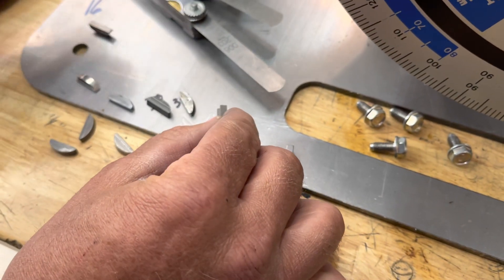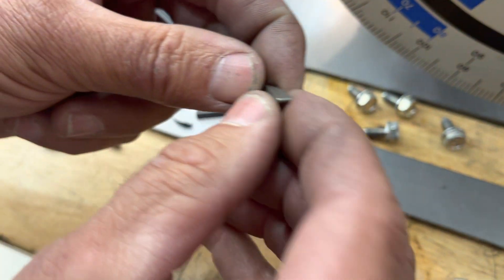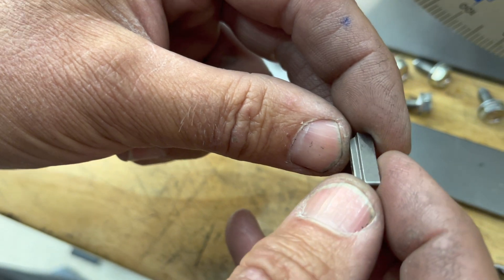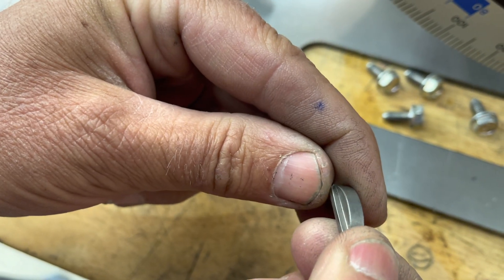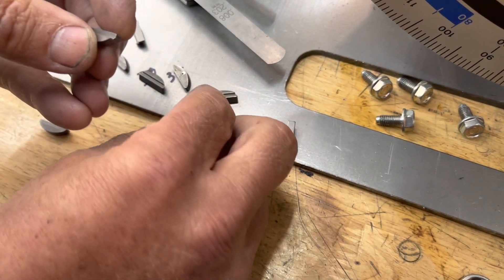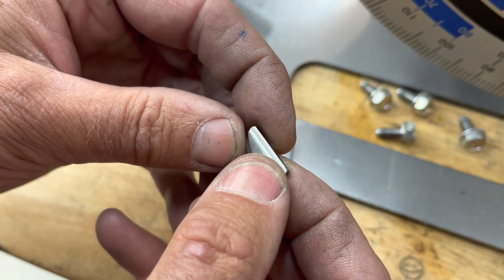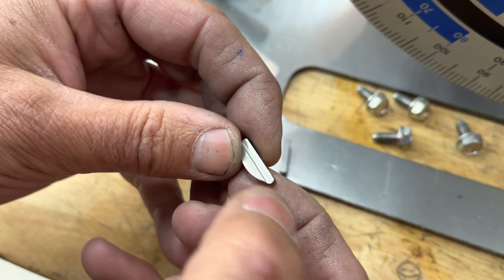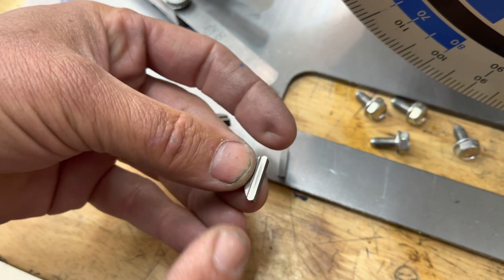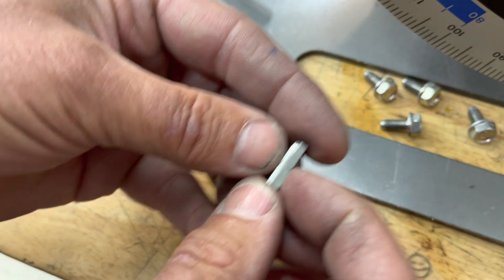Where's the Baker key? This key is a seven key — that's pretty drastic. Now, if you don't want to buy a key like that, you can take a stock key like this and machine the groove in there. Then with a file, you can file across it to fine-tune the key.